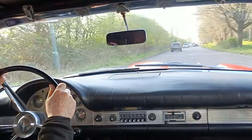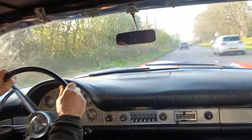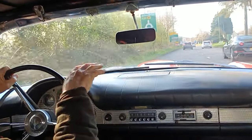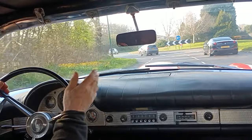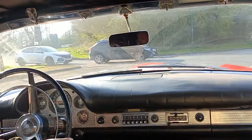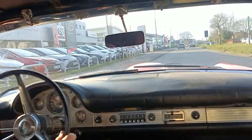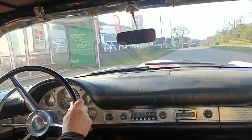That's a success then. I might try and have a look at the distributor next. Because that's a Ferrari there. I locked the points plate down. So I don't know if the vacuum advance thing works, the diaphragm. Test that, see if it does. I've got a new points plate. I ordered a new old stock one. It just cropped up on eBay, so hopefully that'll fit. And I can get the distributor working properly as well.